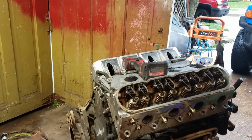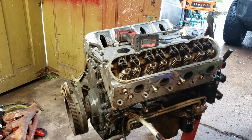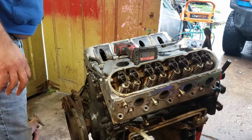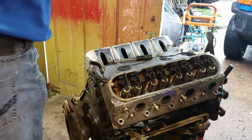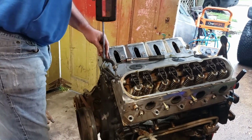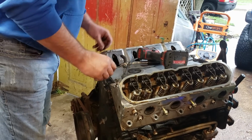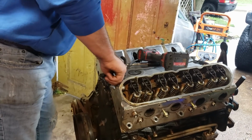I'm usually able to get the valve covers off with the coil packs on. I have to take the front steam port off because it's hooked together. If you have the 4-port, you'll have to take them all off. If you don't have the 4-port, that's fine.